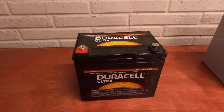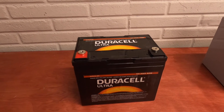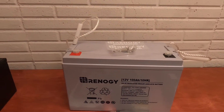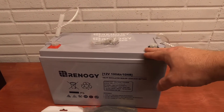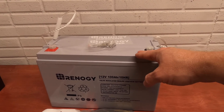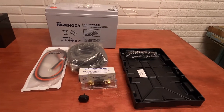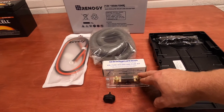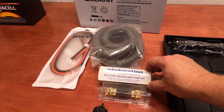Now that I've got the truck fridge refrigerator installed, it really makes a difference. What I'm doing is upgrading the battery — I'm swapping over to the Renogy 100 amp hour battery. This obviously is not going to fit behind the driver's seat. I'm going to make some modifications and put this under the sink in the kitchen cabinetry. I've also got a battery tray and hold downs, and I'm going to modify the fuse system with these Windy Nation ANL fuse holders and fuses.